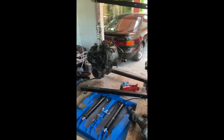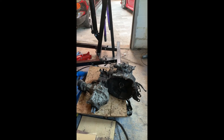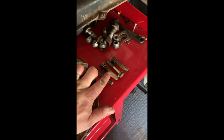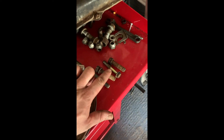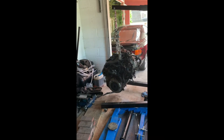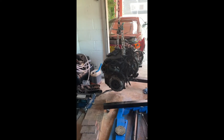So that's the engine and gearbox out, separated, and it's dangling on the crane at the moment. The last challenge I found was — the engine stand cradle is just here, you can adjust it — but the actual bolts that go through the gearbox and into the block that we'd need to use to secure the engine to the engine stand are too short. The supports in the engine stand are too long and the bolts are too short, so we can't bolt the engine stand cradle around the clutch area.